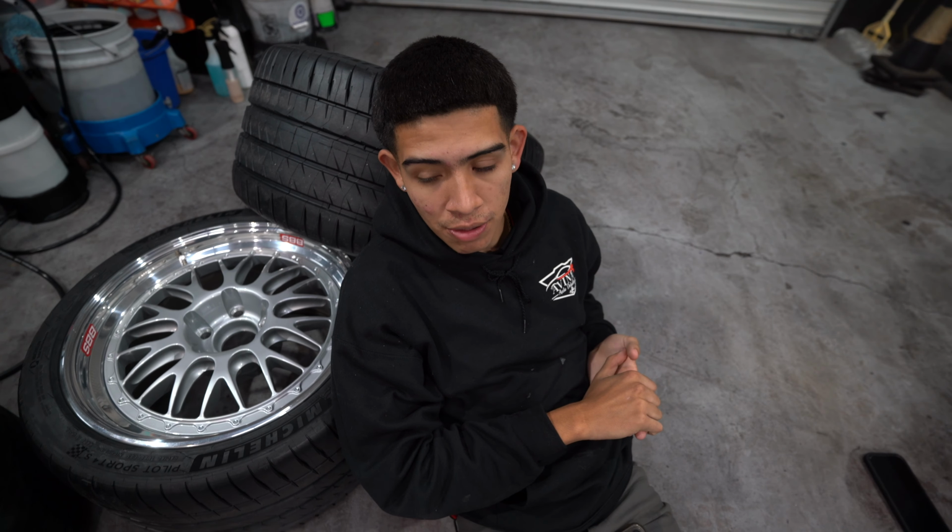In this episode, I showed you guys how I polished the vehicle as well as how I ceramic coated, a little bit of techniques as far as how much ceramic to put, how big of an area to work with as far as polishing. I let you guys know to stay within a shoulder width, not move too fast, how many passes to do and what direction you should based on the area you're working on. Same thing with the ceramic. I didn't want you guys to do a full door if you're not that experienced. But obviously there's some people who can do a full panel, that's not a problem. But for those beginners who aren't that comfortable, definitely work with something that is within your area, within your means, so you don't end up leaving coating or missing anything behind.